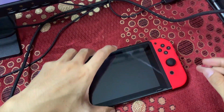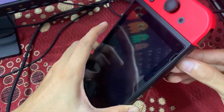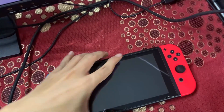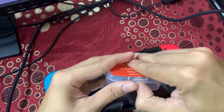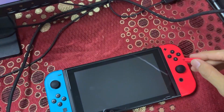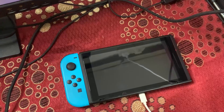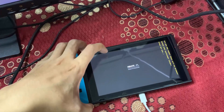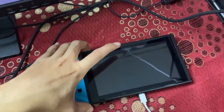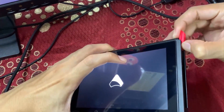Reconnect the microSD card back to your Nintendo Switch. Now you need to boot your Switch into the custom firmware. I'll use the RCM clip here to boot my Switch into RCM mode, then launch it into the Atmosphere custom firmware, just as shown earlier in the video.